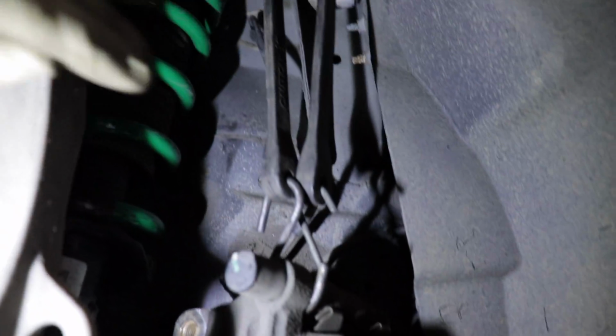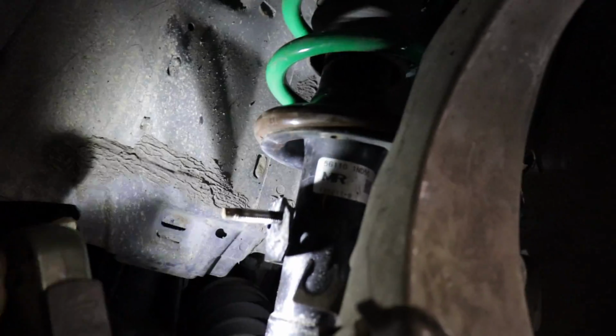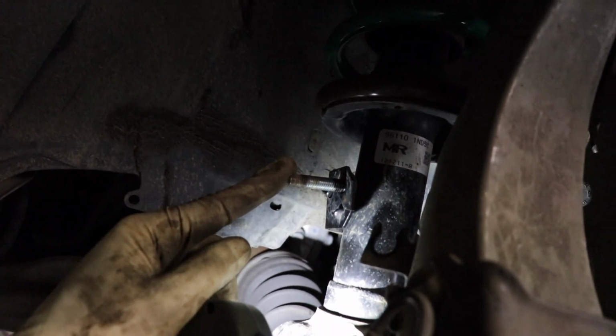There it is, people. So I messed up, people. Don't do what I do if you're gonna do this. The way this brake line routes is it comes out down here. Kind of hard to see with everything I got hanging out. But the hard line comes down here, and it actually routes around the back of the strut. And then the little block bolts to here.